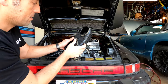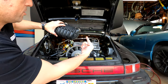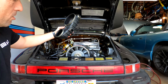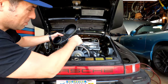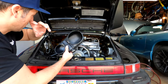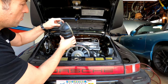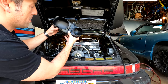Just to show you the various connections: here's the boot as it was oriented. I was able to access the screws here and here — and here's the rear one which had the screw head accessible from the back side. Some earlier cars may only have one connection, or potentially zero. Make sure you poke around yours and know all the connections present before you start yanking on it. Once you have it off, inspect it for cracks or other potential vacuum leak spots. This unit is pretty new so I don't need to worry about it — we're taking this off for demonstration purposes.